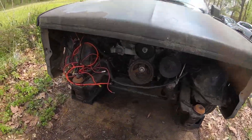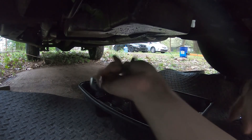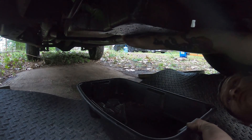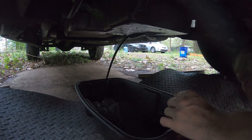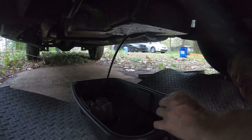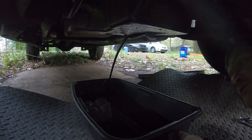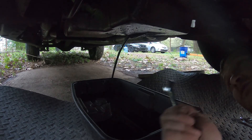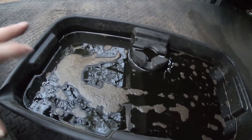As you can see, I've already started tearing this down and went ahead and drained the oil. Let me show you that real quick. It's not the best, it is a little dark, but we can at least see if the motor is damaged or not. It looks like oil — it doesn't look clean, but the dipstick was definitely deceiving. If there was any water it would have come out already, so the water is not mixing with the oil. My suspicions on that were correct — it looks like just normal oil, which is good. There's no metal coloration to it.